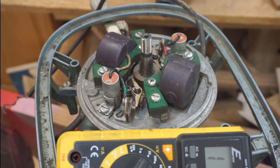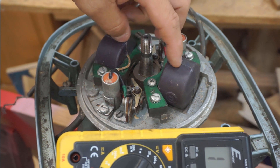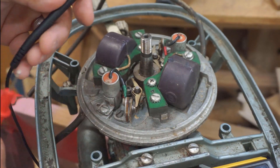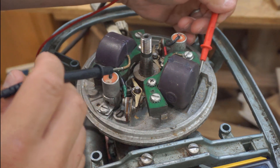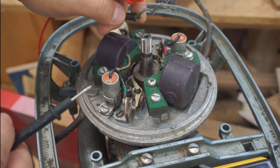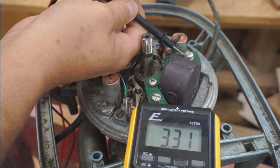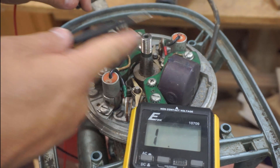Now you need to test the resistance — the ohms. The acceptable range is 3,000 to 8,000 ohms. On your multimeter, change it to 20k range. Some multimeters are auto-sensing so you don't have to worry about it — this is a cheaper one so you've got to set it yourself. Touch the primary wire and then where the spark plug wire comes in. I'm going to touch the end where the spark plug attaches, then the primary. It's reading 3.35 — the wire probably takes a little resistance, so we're in the acceptable range. I checked both of them and they ended up being good.